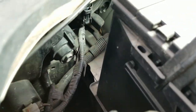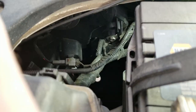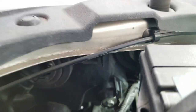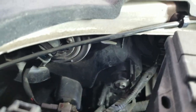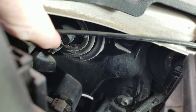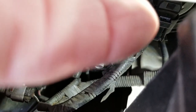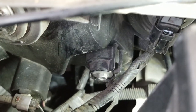We're going to look down here. You can see from the edge of the car, you go down here, and right there — hiding. You can see, at an angle, the low beams and the high beams. High beam is right there, and it's straight up and down. It's got a little clip right there in the middle. You push in and then pop the cable out, then turn the light counterclockwise and pop it out.